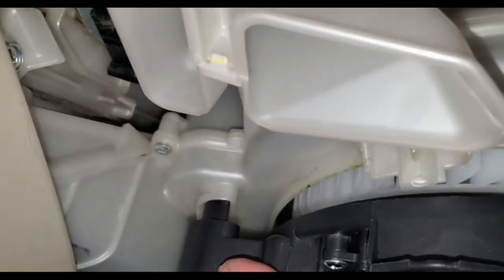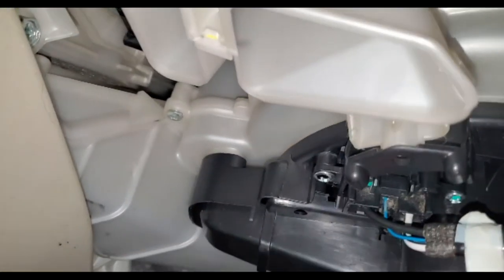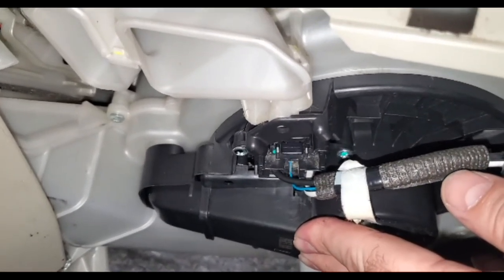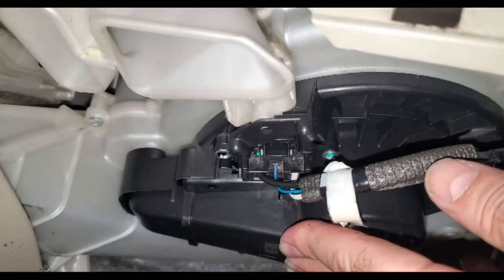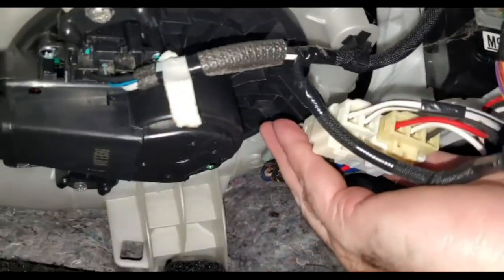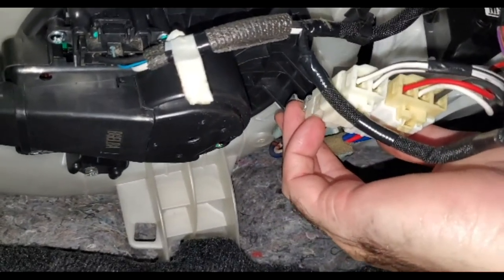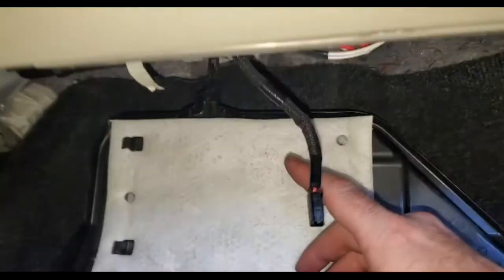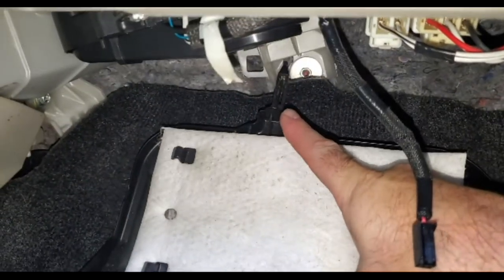You want to make sure that this is lined up in the hole and all your bolt holes are lined up before you put the bolts back in. Start each one of the three bolts first and then tighten them down afterwards. We've got our three bolts back in the motor. Now we want to put our screw and our wiring back up in place with the Phillips head screw. We've got our wiring connected, so now we're down to the last step — put this panel back together. That's as simple as plugging this wire back into the connector, lining the little pin up with the slot, and pushing the clips back up into the holes.